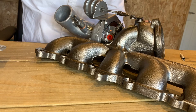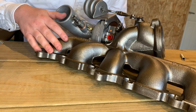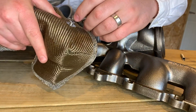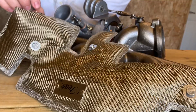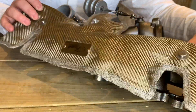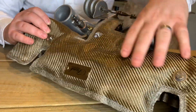We're going to start with the big part of the turbo blanket, which is going to cover the manifold portion just here. You're going to use your springs on the hardest-to-reach anchors first. Fit the first spring there and the second one just over here, then neatly place the blanket over the manifold section — this little tab is going to sit underneath the actuator arm just there.